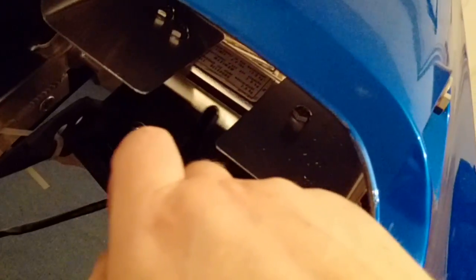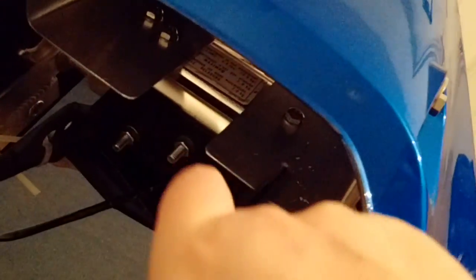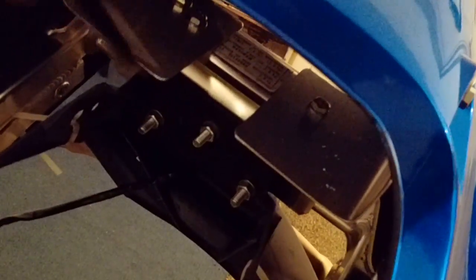That bolts onto the plastic, and the aluminium is bent into an L-shape and bolted onto the bottom of the same bolts that hold the brackets on for the seat unit. These brackets were made last weekend to hold the seat unit on — they've got bolts going through this bit of the subframe, there's like a cross member there, so that's holding these two brackets and the other bracket is bolted onto the bottom of those bolts with nuts.